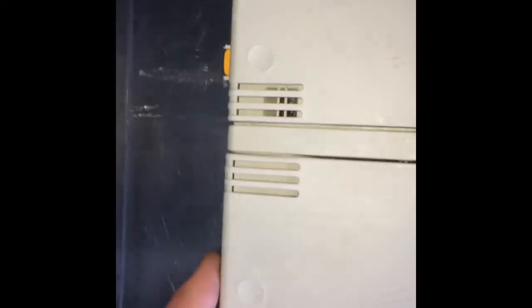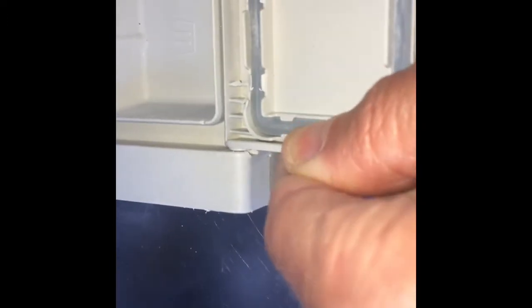When we unlock it, it'll fly up because now it's under spring tension. Sometimes those springs either fall out or become corroded and no longer work, and then your dishwasher won't clean the dishes very well.